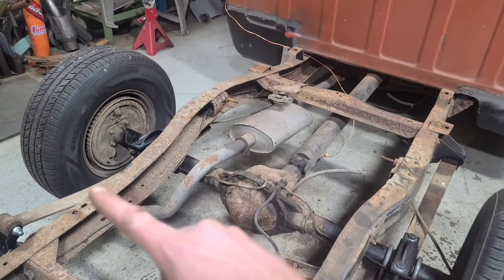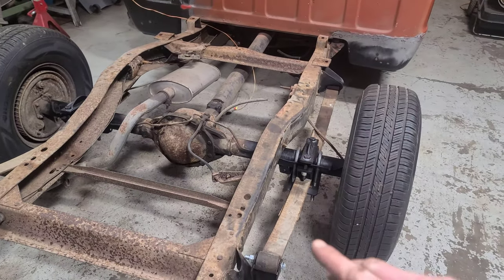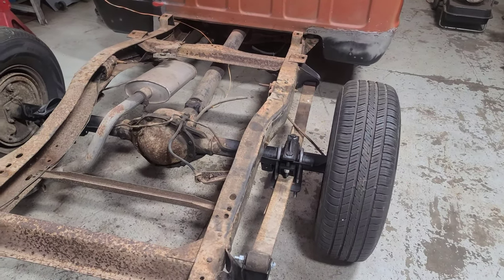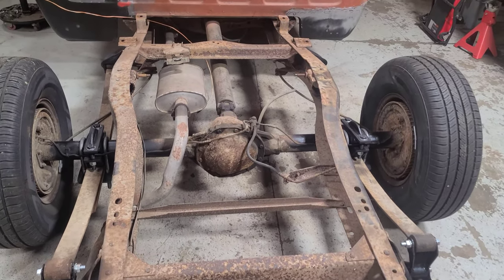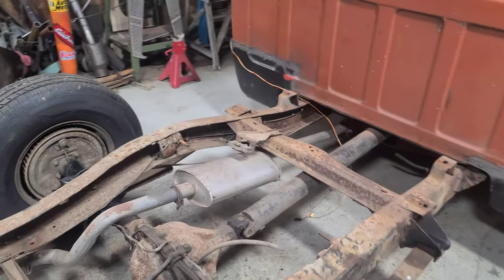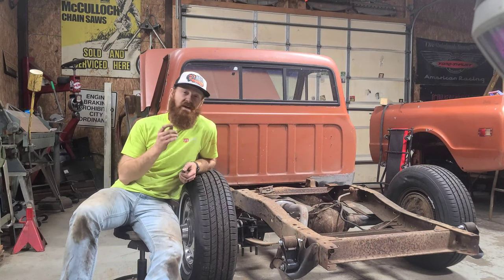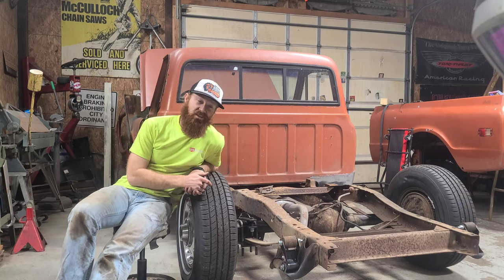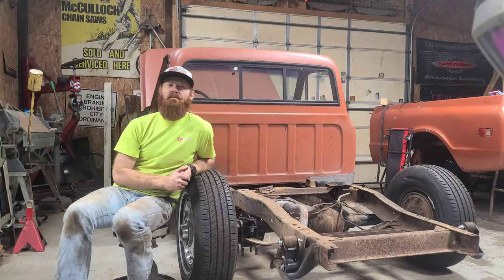If you're going to do this with a mono leaf and just the overload, it definitely made this thing sag a lot more. That leaf spring allowed it to straighten out a lot more than it would have with the extra support of the broken leaves. Eventually we'll probably end up going back with some stock replacement springs because this is a little lower than dad's probably going to want. Keep that in mind if you're putting this kit on — it's probably not going to be quite this low. That's going to wrap up another one — dad's truck is getting closer to being on the road. Leave a like and comment below, and I'll see y'all next time.